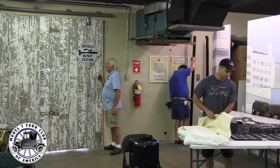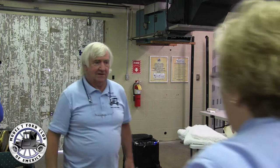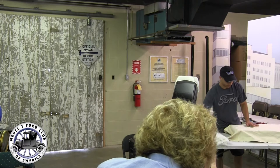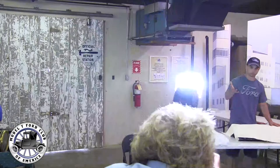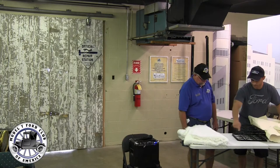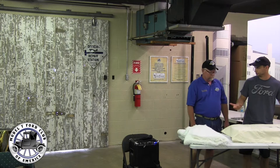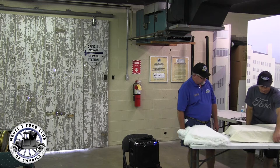After you paint it, you're going to want to take this canvas burlap that I supply you with when you buy your seat covers. You're going to want to wrap this all the way around. What this does is make it so that all the cotton that we put on here doesn't sink into the springs. That way 20 years down the road you're seeing it still puffed — it's not going to sink down and have flat spots. You want to do it nice and tight, because if it's loose then you'll have all that void for the cotton to sink into and your cover will be flat. This is a very important step.